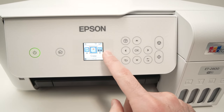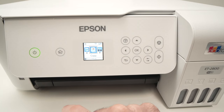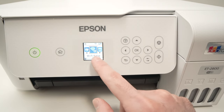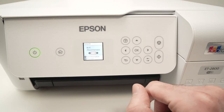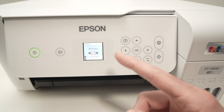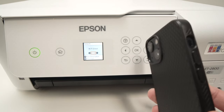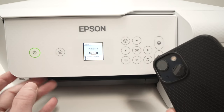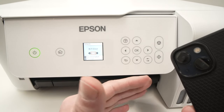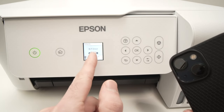On the control panel of your Epson printer you should see the main menu. If you don't see the main menu, simply press the home button and you'll get there. Then use the arrows to navigate until you see Wi-Fi setup and press the OK button. We have two options: Wi-Fi and Wi-Fi Direct. Wi-Fi Direct means your smartphone connects directly to the printer — the printer has its own Wi-Fi network — so you do not need a home Wi-Fi network or any router for that option.